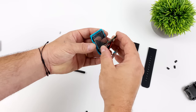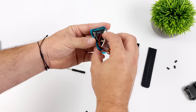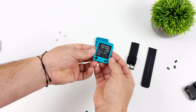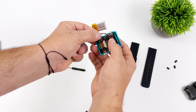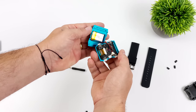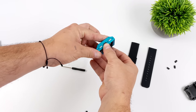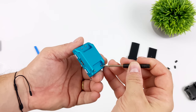I'm going to be swapping this watch face out once we get the new case on it, but now we need to assemble this. I find it a lot easier to assemble it from the front to the back rather than back to front, like I think it says in the manual — for me it just makes it a little easier. I'll make sure I get that screen lined up; it should click right down in here. This is milled out perfectly — it lines up perfectly inside of this new case. Now we need to go ahead and get the back on, and that battery is going to fit right in the notch on the back of this case. Once we have this together, we've got four screws for the rear, and now we can add the band.